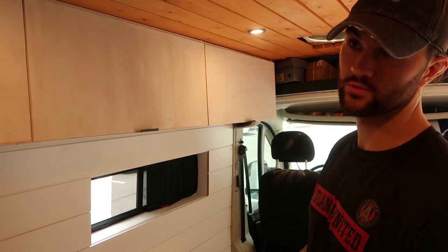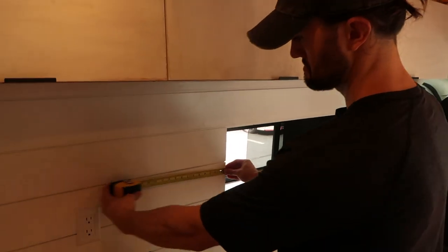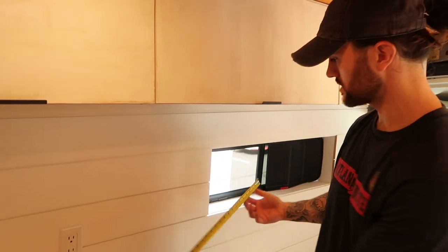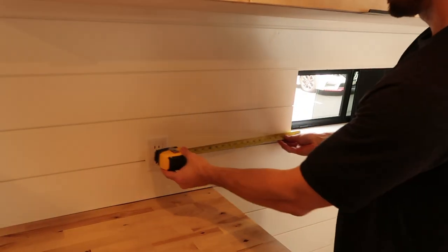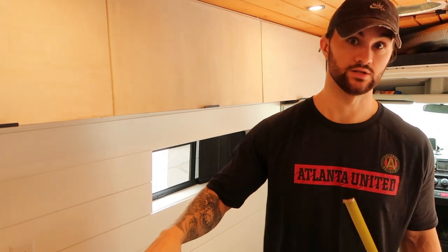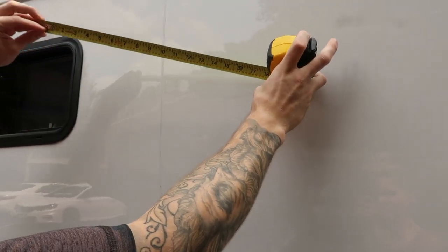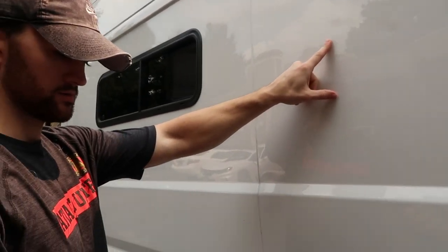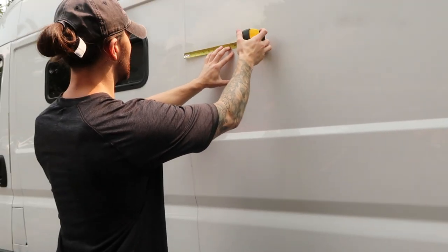The way we are going to get an accurate depiction of where this hole needs to be — we decided we're going to measure the distance from this window to the closest point of this vanity where the hole could start. So that's about 18 inches away, just directly below this on the floor. So we're going to say about 18 inches. And then now we're also going to go to the outside of the van and measure 18 inches from the window, go straight down, and make sure there's no obstructions under the van that would hinder our ventilation system. Now we're on the outside. We're going to measure 18 inches from the window — just about right here. I'm going to also measure from the seam in the side of the van here for another frame of reference, and it looks like we're about nine and a half inches. So I'm going to bring this down to the bottom.